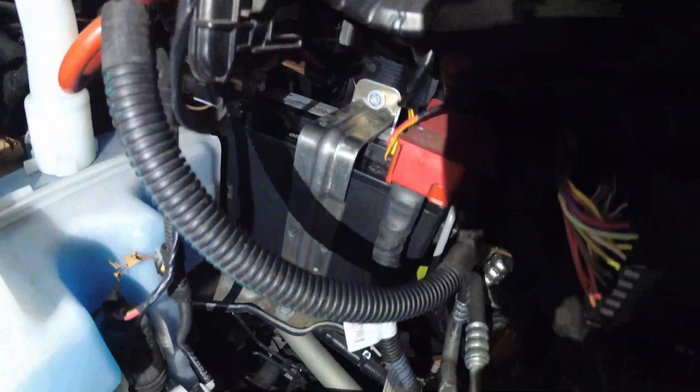When you put the battery back in, you can see it kind of snugly fits right in there along the holder. Attach the negative terminal — put it back on the post and tighten it up with the 10mm bolt. Same with the positive terminal — it just kind of slips on there, it's actually not too difficult. At this point, it's also a good idea to reattach the drain hose — it's a press fit, so not too difficult. The last thing you need to do here is reinstall the bracket with the 10mm sockets. Get those nice and tight.